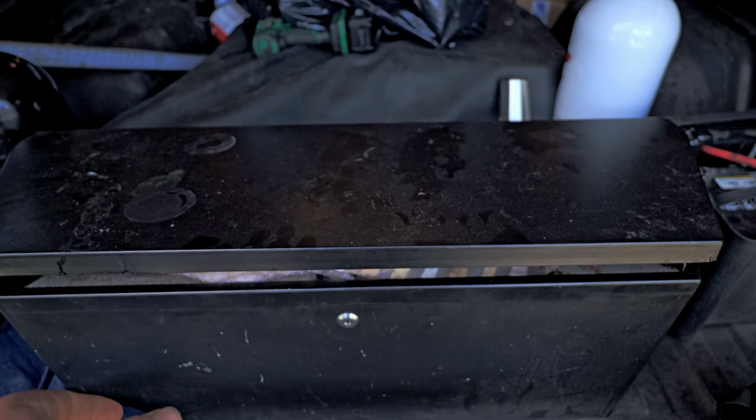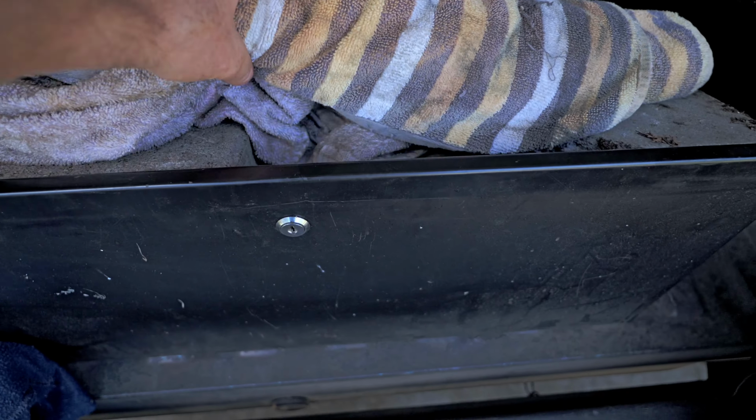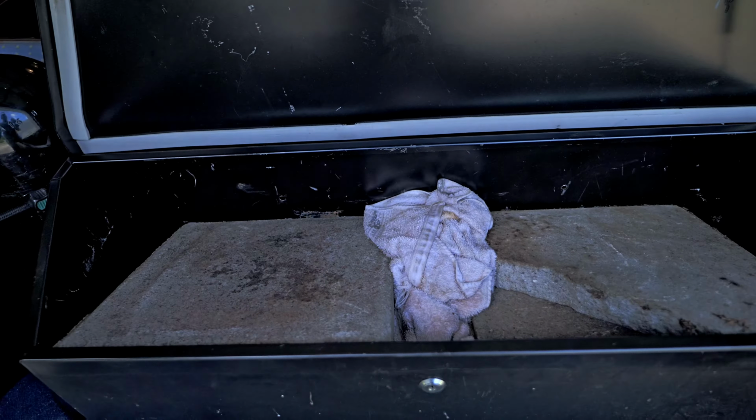But that was a no prep event, and if you're wondering how I was getting it to hook up at a no prep event, we'll call it some prep, because they actually scraped the front half of the track, but it was still pretty darn good. I probably didn't even need all that weight, but I just put a whole bunch of concrete on the axle right there. Not the best, because it's a sprung weight, but we'll go over more of that in the future. I'll try to get my traction better without using so much weight.